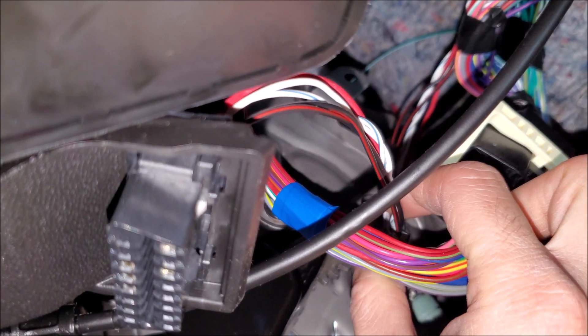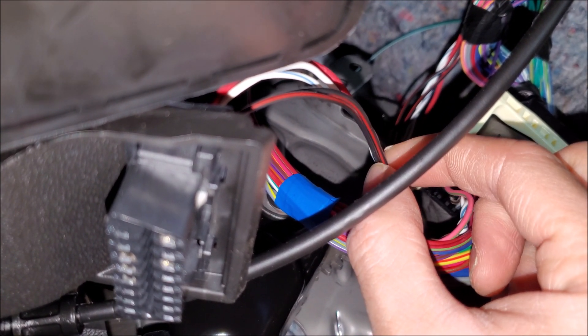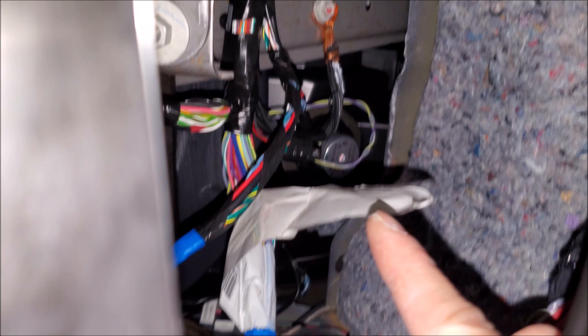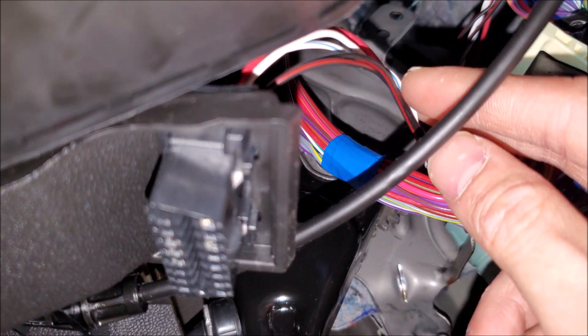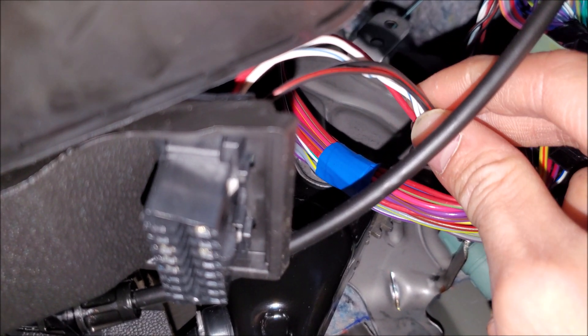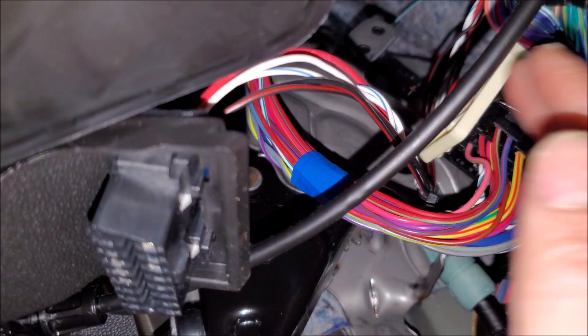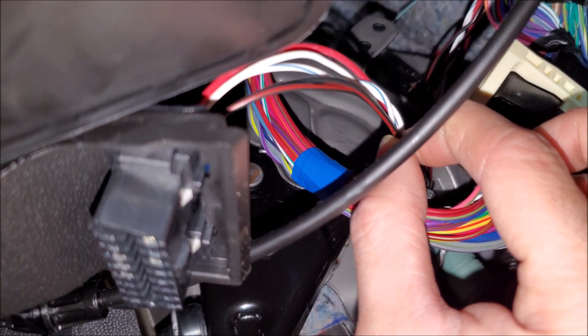You can ground off the OBD2 as well. I know a lot of professionals do it for low current remote starters, but I actually stay away from it. I've done diagrams where they recommend grounding here, but I'll end up going to a factory ground. Tread lightly when going onto the OBD2. Thinkware actually creates an OBD2 plug — they're testing it and backing it — but personally I stay away from this area.